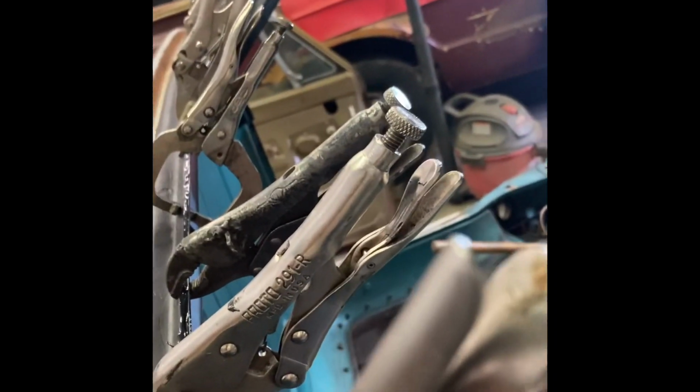So I've got the panel in here. Five screws on top. Self-tapping sheet metal screws on the bottom. I've got most or all of my excess panel bond that dripped everywhere cleaned off. Only thing I really am going to do now, this gap here looks really good up on top, up on the lip. I'm going to try to get down under here. I may have to do it later. Any place that doesn't look like it's up tight, I might try to get a little panel bond on my glove and stick it up under there just for good measure.